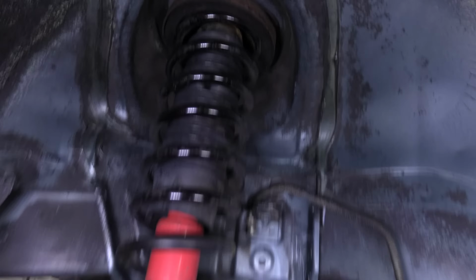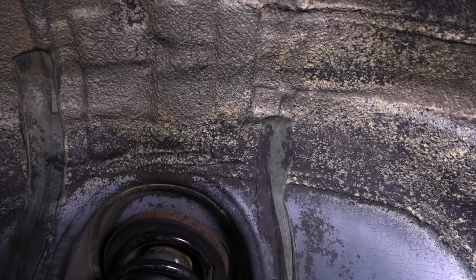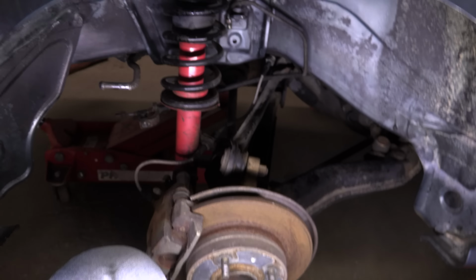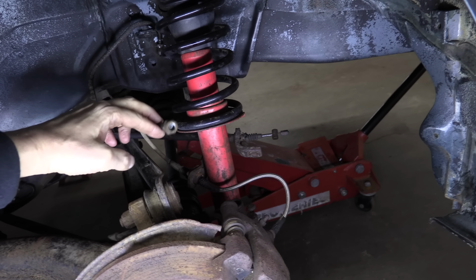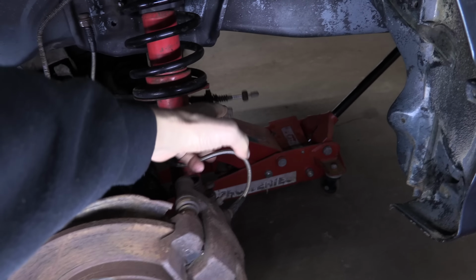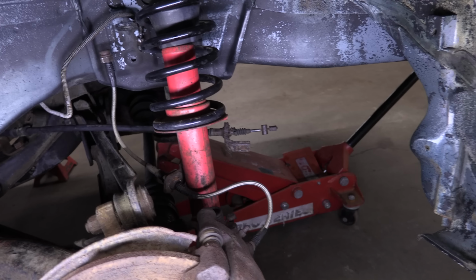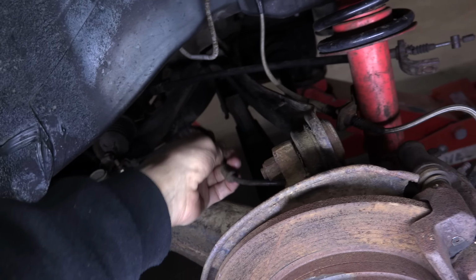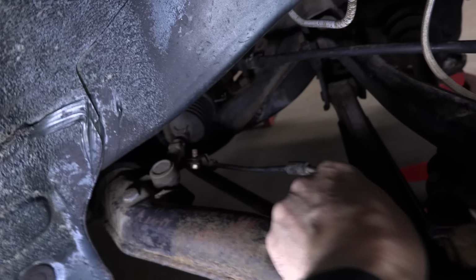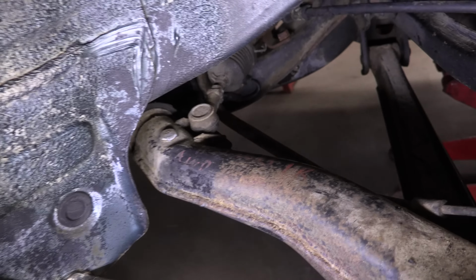But enough gloating. I came here to get down, literally, on the floor. You thought I was done with all that stuff now that I have this fancy lift here, but nope. Some things are still easier to do on the floor. Pay close attention to which lines you need to unbolt from the body. The ones that are bolted to the subframe can stay, because we're removing all of that together in one piece, but some of them secure to the body. Just pay attention, like I said. Lowering a completely assembled rear subframe a whole foot instead of 7 feet and over your head is much easier. It's simpler, it requires less tools and people.